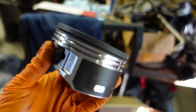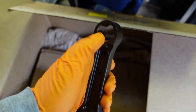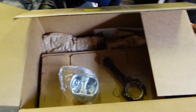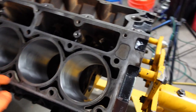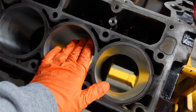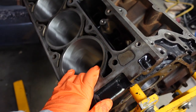They don't look awesome, but they are new pistons and they are the right size. My stock rods, reconditioned still. The machine shop also checked out the pin bushings, made sure they fit okay on the new wrist pins, and they're fine — no significant wear on the wrist pin bushings. Some of you are yelling at your phones: 'It's an LS, just grab another one from the junkyard!' Well, first of all this is a 6-liter, flat-top-piston LQ-9. These are not really super common, not in every junkyard. Second, if you could find one, they're not 500 bucks anymore. The ones I've found have been $1,200, $1,300, $1,400 — and they had 200,000 miles on them already.